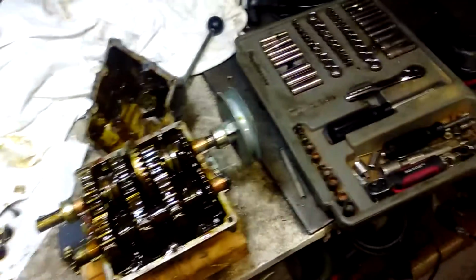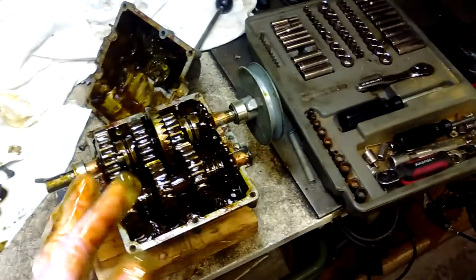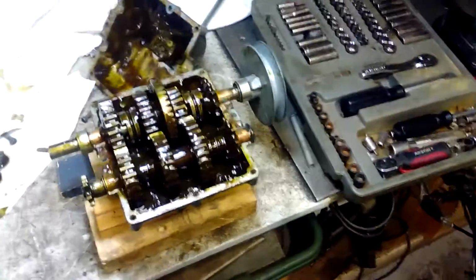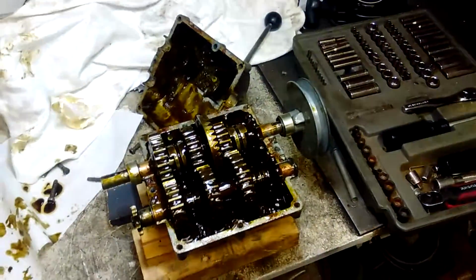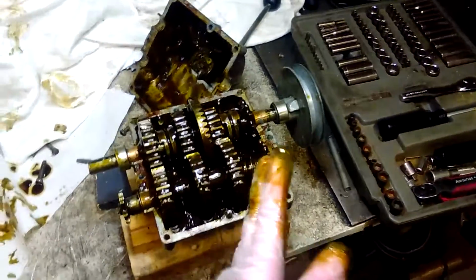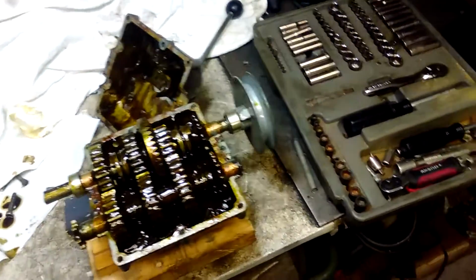There's a lot of things that you've got to worry about, but just the stock 212 or even lightly modded 212 Predator, this will hold it all day, no problem. And it's fun as hell too. It goes through the gears. It's like really close gear ratios, so as long as you've got it geared right, it's going to be fun.